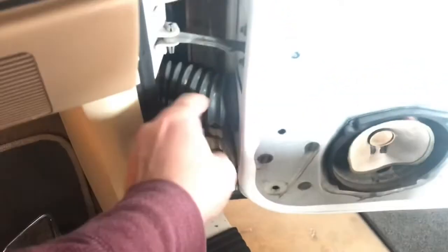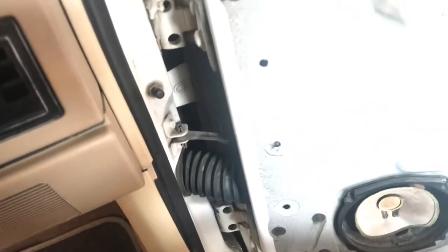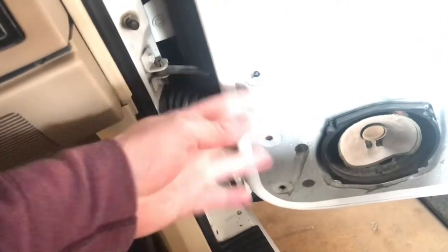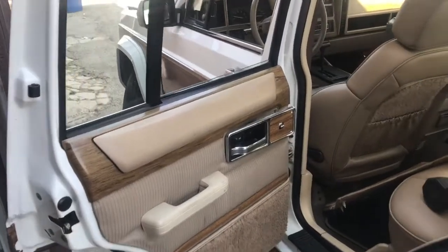Take off this accordion. All the early GM cars, so going back even further, 70s, 80s, they would always break in there. And people would try and repair them right there. You cannot repair wires in a hinge area. They will never work. They'll just keep ripping. So you have to properly do it. You got to run 2-3 feet of wire and repair it under here. Make your connection. Run it through. That's the right way. All right, so back on the left side.